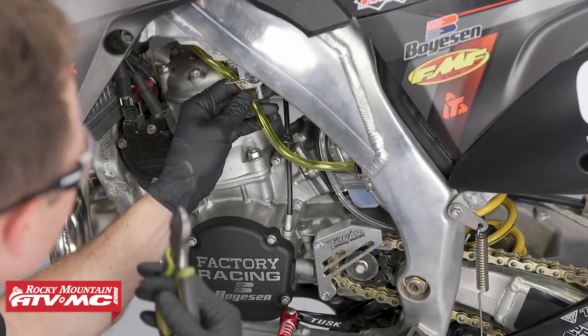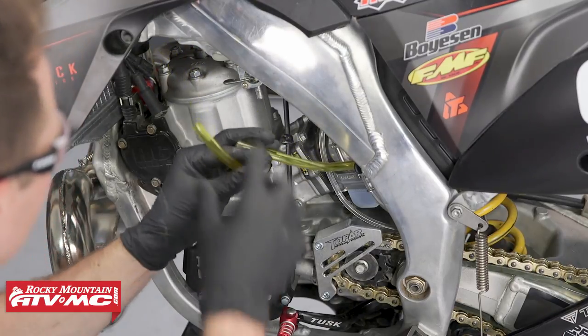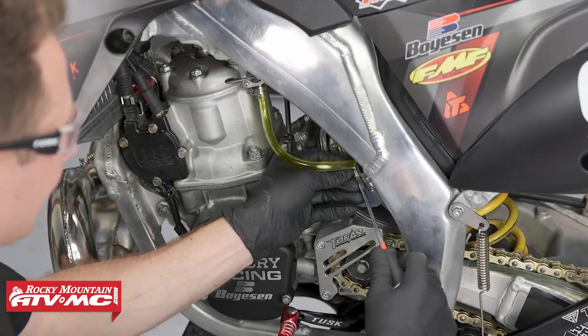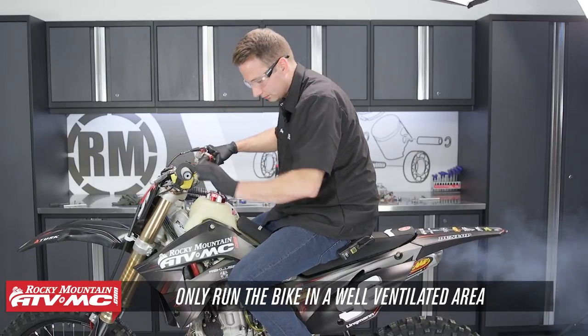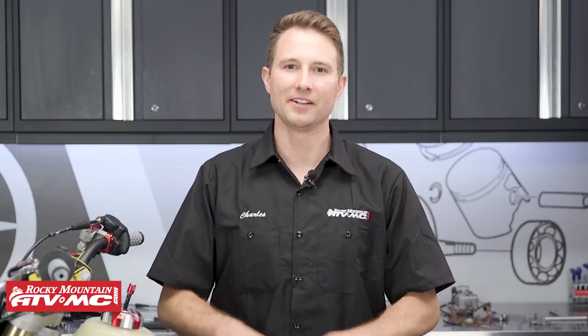Now I'm going to reinstall this slide and put everything back together. In our carburetor we obviously have way too much fuel line, so I'm going to go ahead and trim this up. I'll put the clamps back onto the fuel line, get everything installed, and tighten these clamps down. We'll turn our fuel valve on, start the bike up, and make sure everything runs well — and anytime you're doing this, make sure you're in a well-ventilated area. And that's all there is to installing your Lectron carburetor on your two-stroke dirt bike. It makes a huge difference when you're going on rides with a lot of elevation changes, or if you just don't ever want to mess with jetting. Check out our website for parts, and subscribe to our YouTube channel because we have a ton of other helpful videos. Thanks for watching.